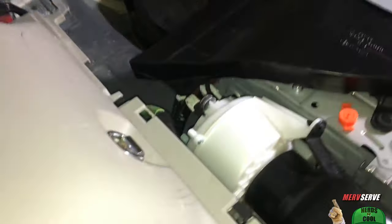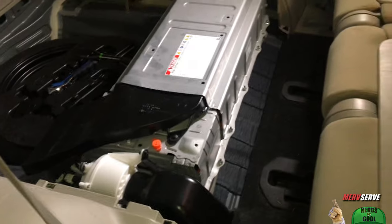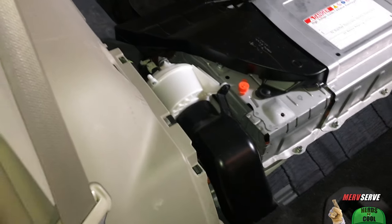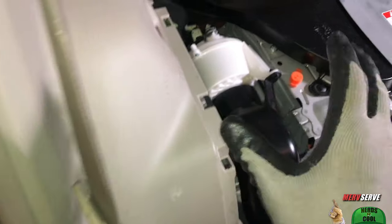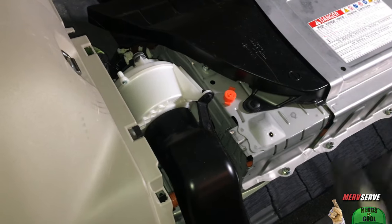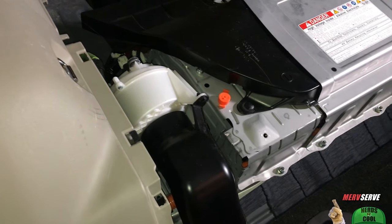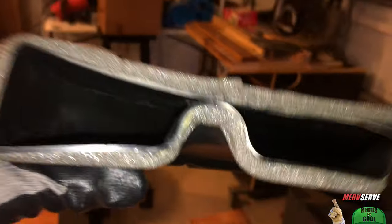This is the area we're going to be focusing on — that's the cooling fan. You've got the duct and the vent coming out of it; the fan leads to another duct that goes under your back seat and comes out under the seat there. Different design than the standard Prius — on a standard Prius you'd actually have to take the whole thing off to get at it, but we ain't gonna do that. I'm going to pry this push pin out of the way so we can remove this vent that comes out the side of the housing for the high voltage battery.